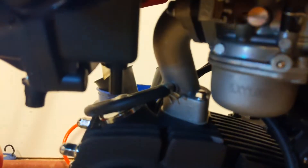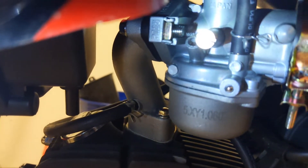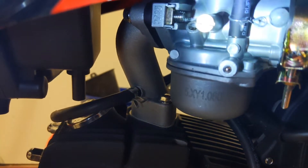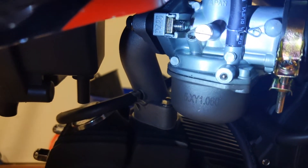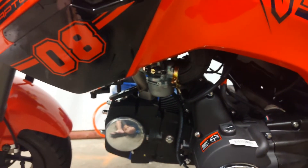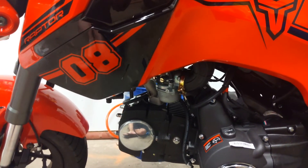Again, there's that brass pin in there to the left of the idle. You're going to pop that out because they don't want you messing with it. You're going to actually turn it to 1.5 from the 0.7 — turn it clockwise, not counterclockwise. Once you adjust that, you're going to have to adjust your idle on this because it's going to be kind of messed up.